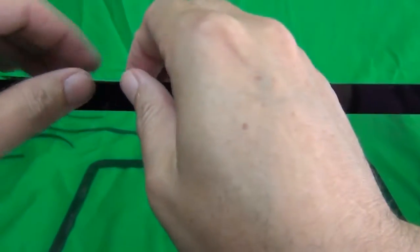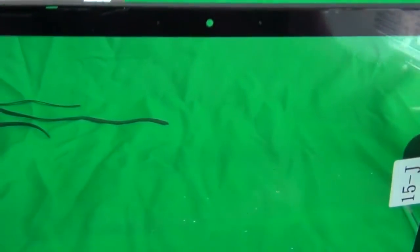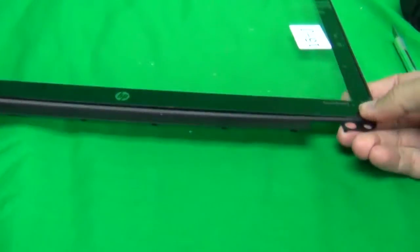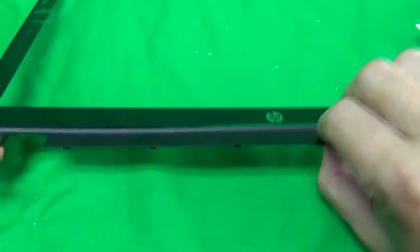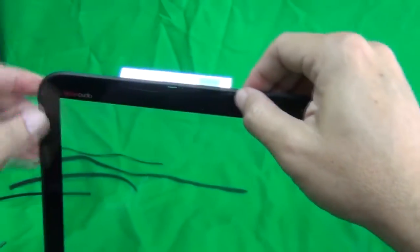So we take it off and then fold this part, this metal piece. Make sure that it goes through first, and then carefully line up the edges so everything's lined up on every side, and just slowly put everything back in place so it snaps back in place. And I think we were able to do it like so. So the digitizer is back in the bezel.